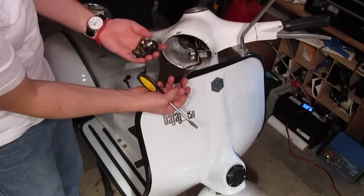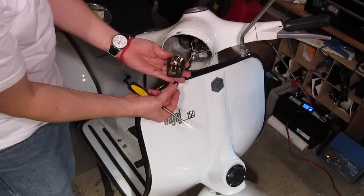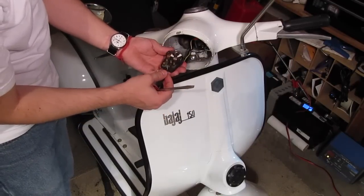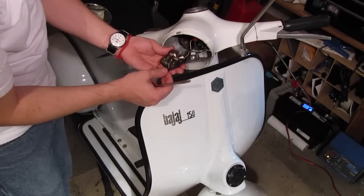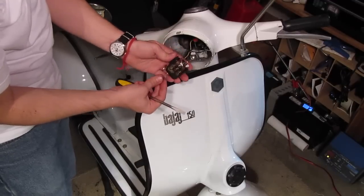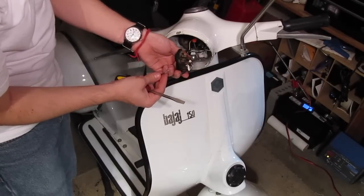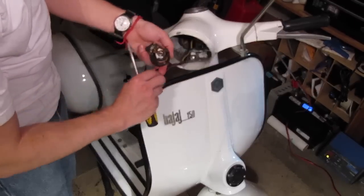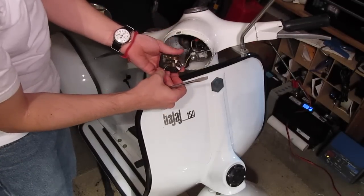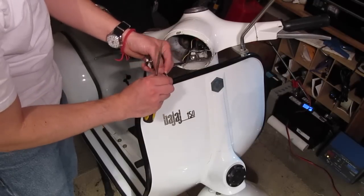It's going to require a little bit of rewiring. Originally it had the ground in here and then high beam, low beam. This is now ground. But the original ground is sort of still touching the chassis of that thing, so I don't trust putting it back there. So I'm connected to what is now the center pin here. I'll fold some of this over.